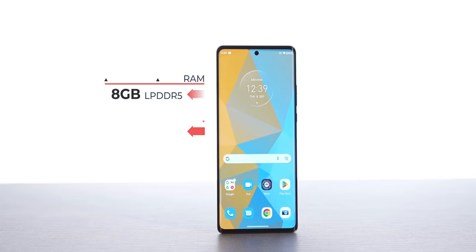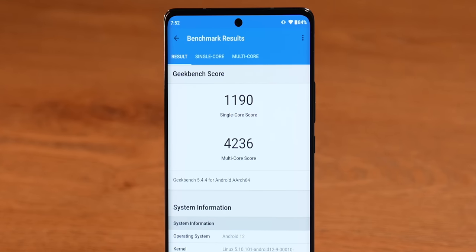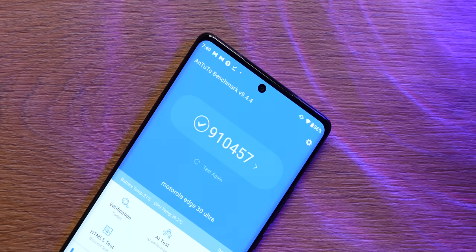Coming to performance — the Motorola Edge 30 Ultra comes with the Snapdragon 8 Plus Gen 1, LPDDR5 RAM, and UFS 3.1 storage. This is the 8GB/128GB variant; a 12GB/256GB variant has been promised but hasn't been seen yet. In benchmark testing, we got the best multi-core score on an Android flagship to date on the Edge 30 Ultra. However, in Antutu I couldn't get it past the 900,000 mark — it never touched 1 million, which is generally the case with most 8 Plus Gen 1 phones. I believe that's a problem with my unit, as GSM Arena's review did breach the 1 million mark.